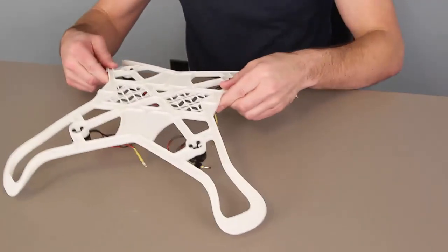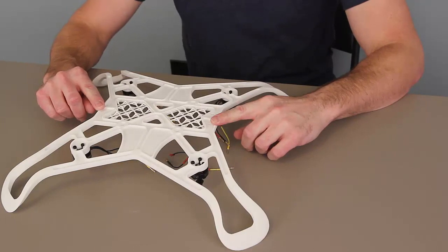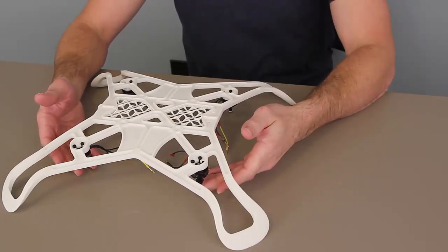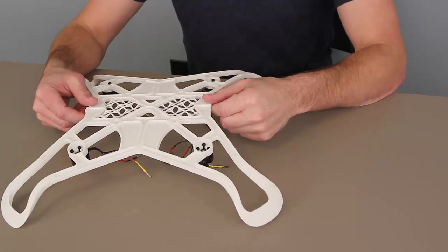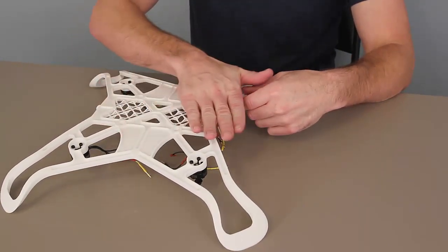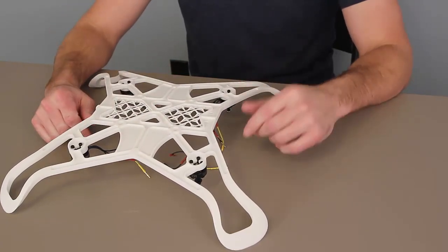The one that we designed for the course, however, had our very specific design intent. We wanted to make sure that the motors were upside down and that we protected the props as well as the motors and all the components. We have this large airframe to allow us some flexibility when we land or also if we bump into anything, walls or ceilings. We made sure that the entire top of the design was nice and smooth so that we didn't hit any obstructions if we were flying inside of buildings.